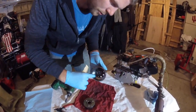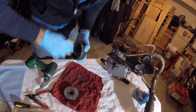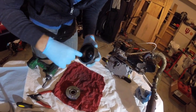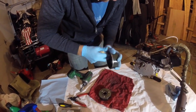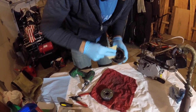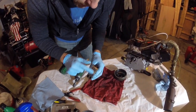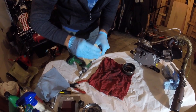Next, you're going to sand the contact patches. You can see it here in the bell — this dark area. Sand it with 220 grit sandpaper. You're not going to be able to take off that dark patch entirely; you're just going to get off whatever you can. A lot of times when you go over it you can feel it gripping your glove or finger. Try to take as much of that off as you can. Now the bell's been sanded. Move over and sand the shoes — try to take off as much of this sheen as you can, getting it looking as close to new as possible.